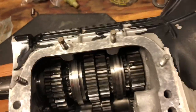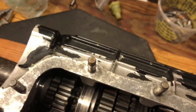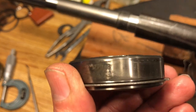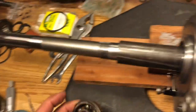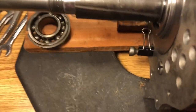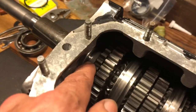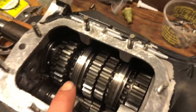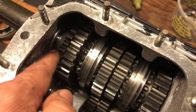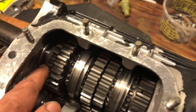What we've been trying to do with a couple of test assemblies is to put in the correct spacing. The problem results from the stock bearings having bigger inner races — you can see how those protrude — but these are no longer available. The actual removed bearing has equal races; there's about 95 thousandths of an inch difference that must be accounted for. I've made up the difference using the thicker shim from the med gear set — the 2.5 millimeter, about a tenth of an inch — instead of the one that's about 68 thousandths.